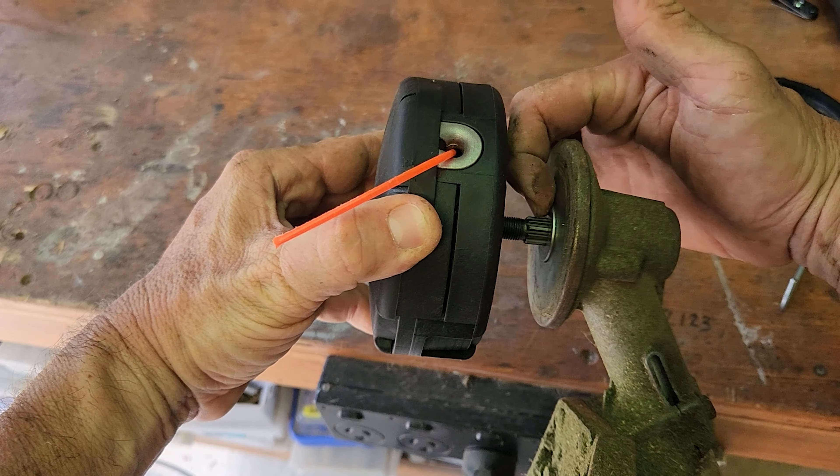What I've made out of pine is really easy. It's probably about 6mm thick, the hole is 25mm in diameter matching the cover plate. This is just a bit of wood - I've painted it red. It goes on like that, and this goes on like that, and this goes on as well. Get the key into place. You can already see how that big washer, or bush, works. Tighten that up a bit more and it solves the spline clearance issue.